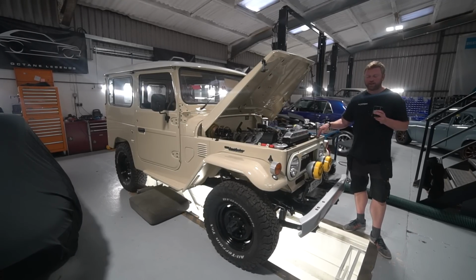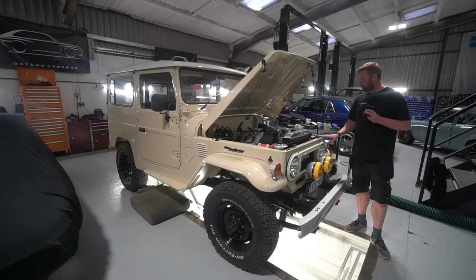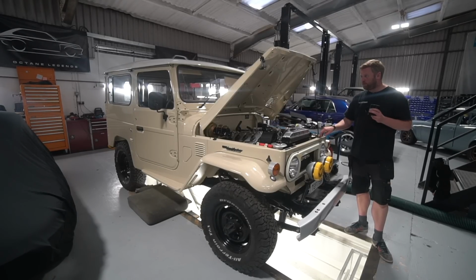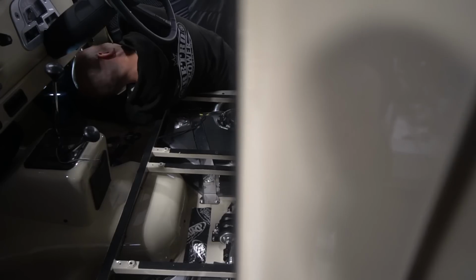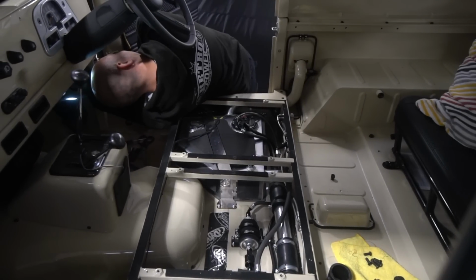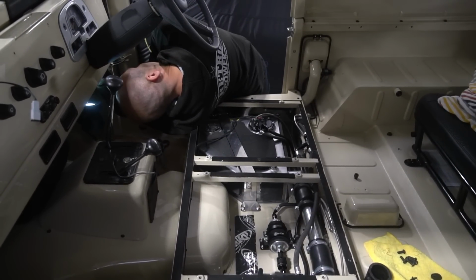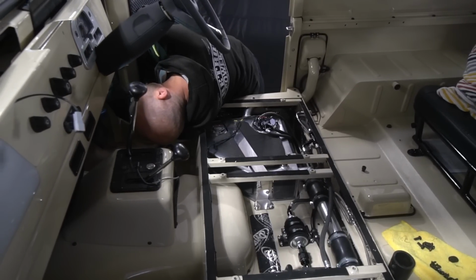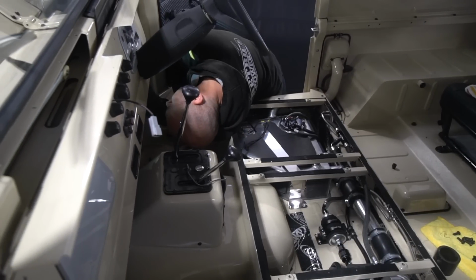Now Samco do a range, but they don't have any in stock and it's on a massive lead time. So another company, and off the top of my head the name has escaped me, I'll get the title put on, another British manufacturer, very helpful, will do it to order. They're doing us a metre of Viton lined rubber fuel hose of the right diameter, and I hope, and they certainly think this will be the case, that will solve our problem. So just waiting for that to be made, and we can get that in.